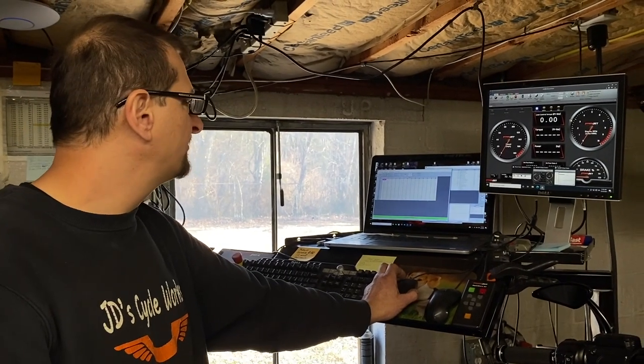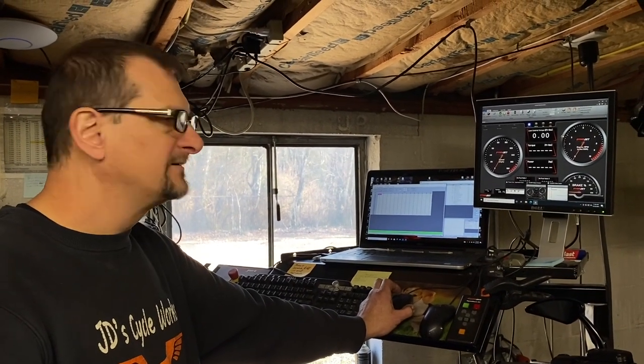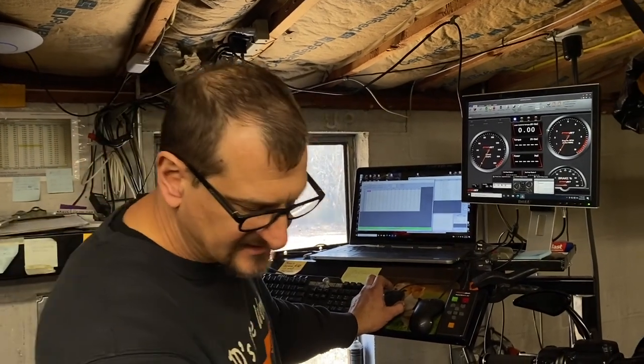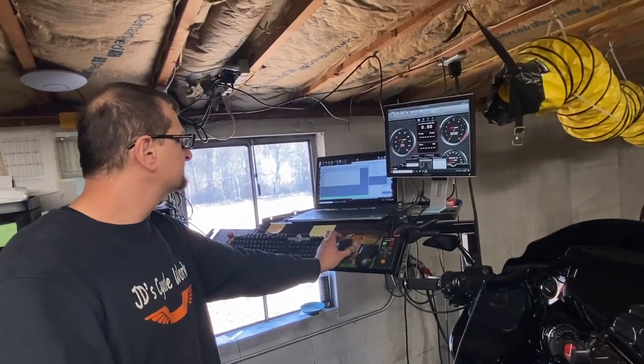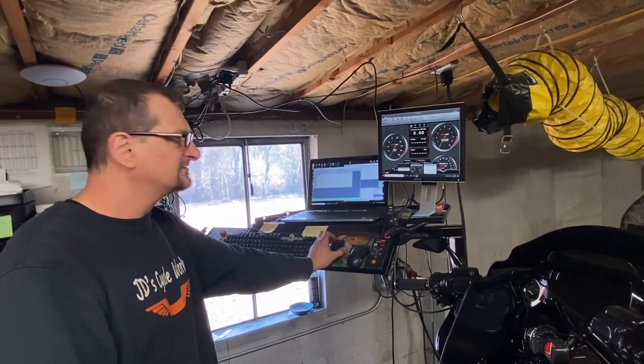I got you. That's why it's important. These pipes are different lengths, or pretty much the same? And they will scavenge differently, and that's why you have a really bad exhaust system. You'll see these numbers really skewed in different areas, and you'll see a loss of torque.